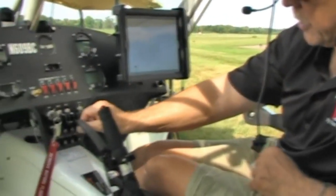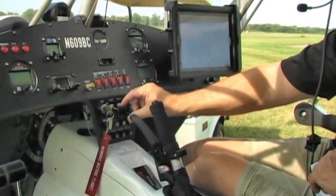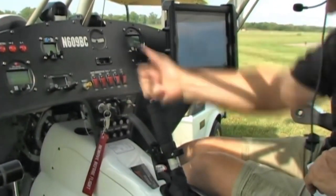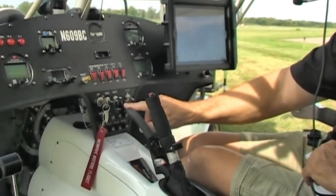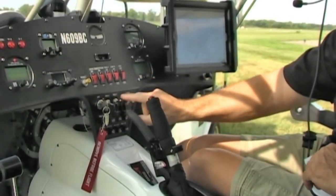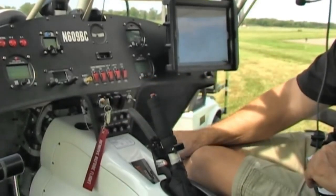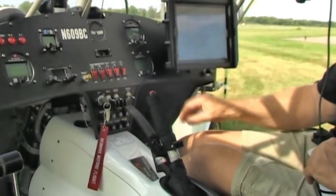One thing I like here is the magnetos. These are something that they're in the off position now, and sometimes these are called hoods here, and sometimes they are reversed the other way and they keep you from inadvertently switching something off, and indeed they work that same way here too, but when you switch them off and then you put them back on, now that is going to push that back into the on position. So if these guards are up, that means the magnetos are hot. I'm going to put them back down and switch them off because we're not getting ready to fly here.